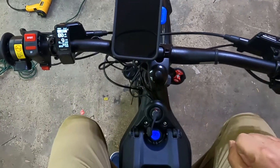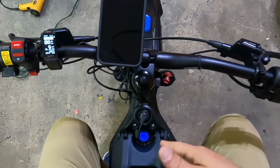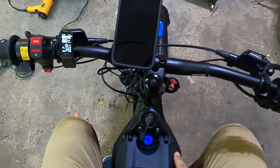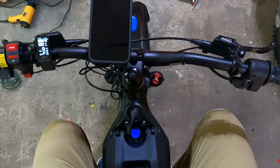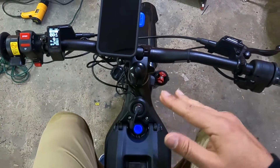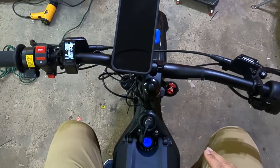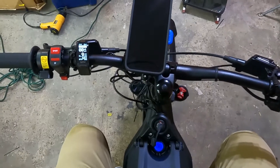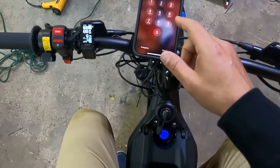The reason it's cutting out is because the battery is saying it cannot handle that current, so it shuts down. Not every BMS has the same power — some cut out early, some give you more current and cut out later. There's a way to tune that, which is why you need to download the app and adjust your settings.